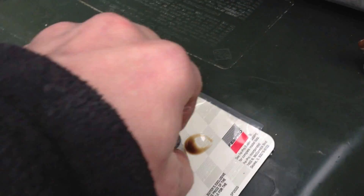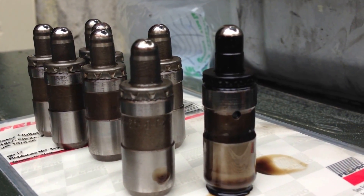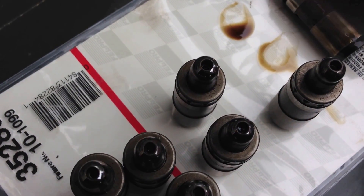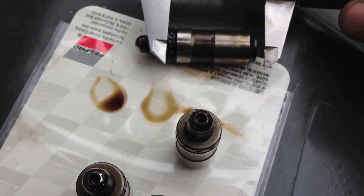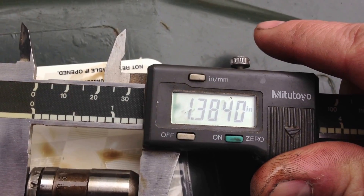Set these side by side — you'll see it's a little bit taller. What I've got is a digital caliper. You don't really need this many digits; three decimal places will work. So we're going to measure this. Get it square. 1.494 — I've seen about 1.5 average on these things. 1.492, we'll call it 1.5. This is not terribly precise because that's just a cap on the top of these. We'll measure this one: 1.384. So I'm calling them about 0.12 difference.